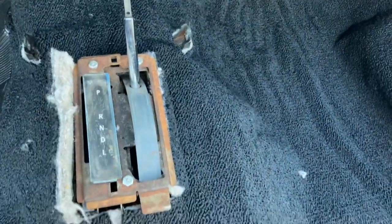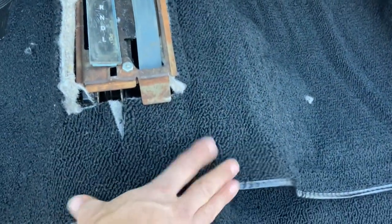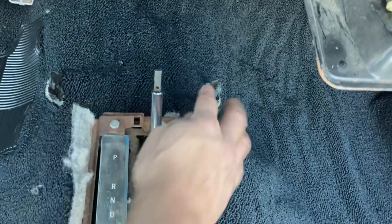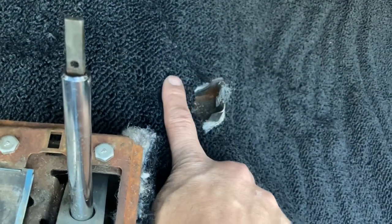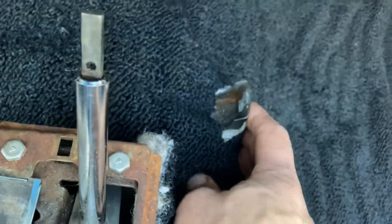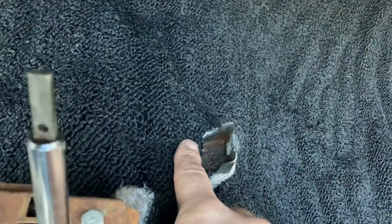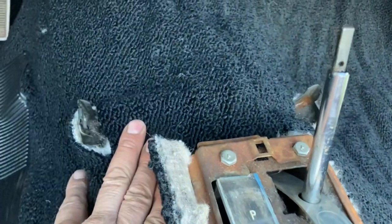You can see I was hacking away around the shifter. My distance forward and back is okay, but you want to get cut around the shifter to get the carpet sliding over the transmission tunnel. This is still the center point and I work my way out. This is where the center console front ears poke through. I had the carpet laying on top and could feel this through it. I cut it almost an inch to an inch and a quarter in on purpose, knowing when it pops through it's going to slide this way — I didn't cut it right on top. I want this to pull down tight, so I kind of stretched the carpet. I think it's going to work pretty good.